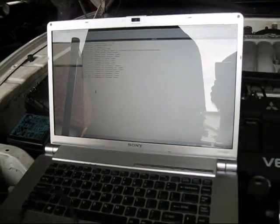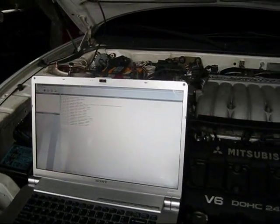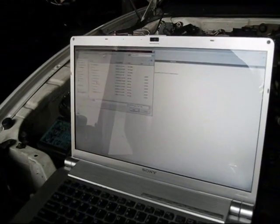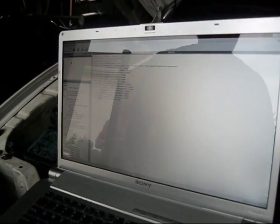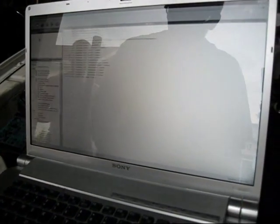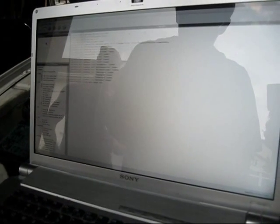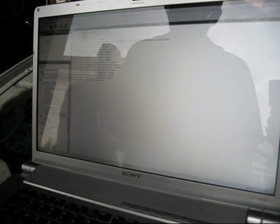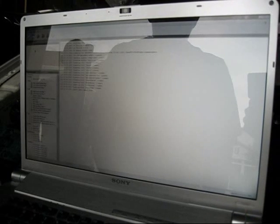What I'm going to do is write a tune, starting with a stock tune. The name of this ID is right here. There are three versions of the ROM that came on the ECU stock: 004, 005, and 006. 006 is the newest version — it was the one we decided to disassemble. Honestly, there doesn't really seem to be any difference between the three aside from a few bits, so it would be very easy to write a definition or disassembly file for the other two versions.